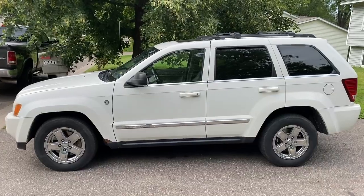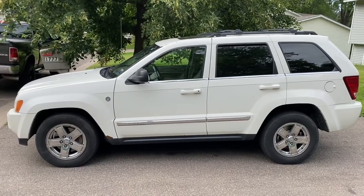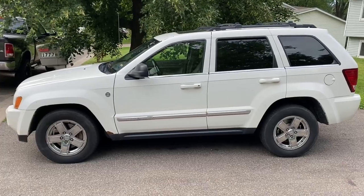Drive the Jeep and hit the brakes moderately to heavily a couple of times to break in the new pads. Make sure to pump the pedal up before putting it in drive — the pistons need to push back out on the first couple of applications. If this video helped you, hit the like button and subscribe for more videos. Check me out on Facebook at Tony the Truck Guy — thanks for watching, have a great day.